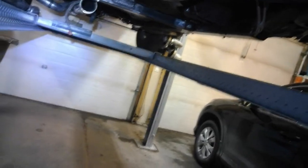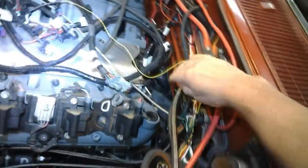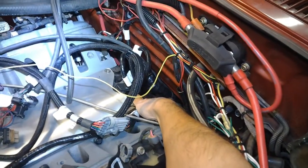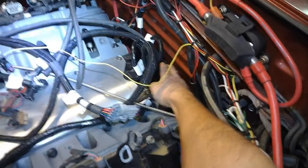I'll show you the battery, then I'll show you the harness routing from the top side — from inside the car and inside the engine compartment. From the top side here, right there is our clamp for the harness and I've got that fastened to the underside of the transmission tunnel, so it's holding it nicely coming through here.